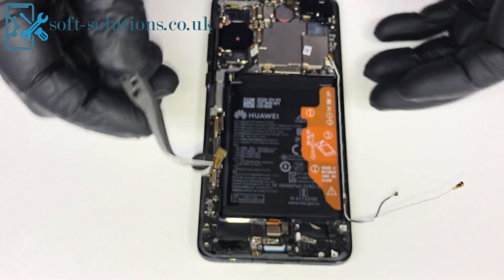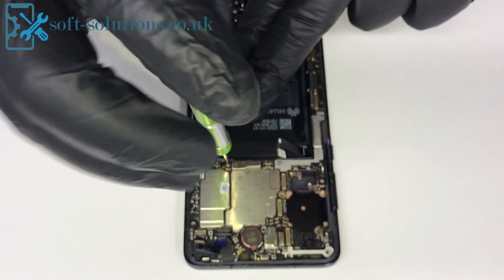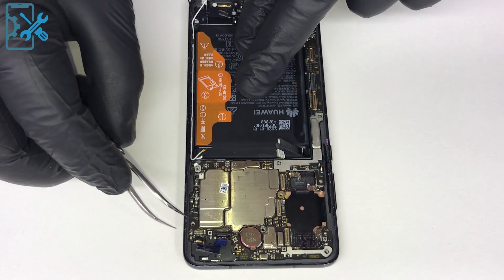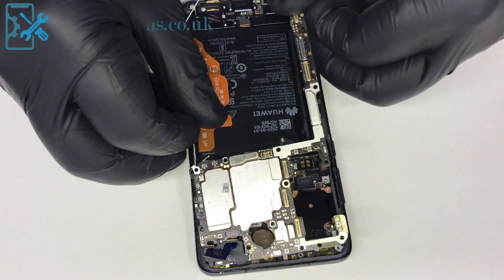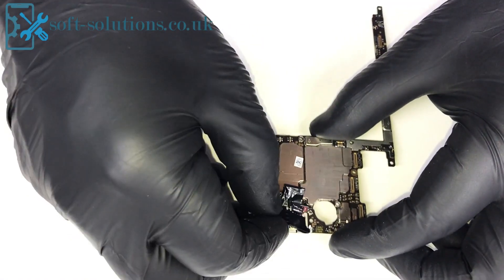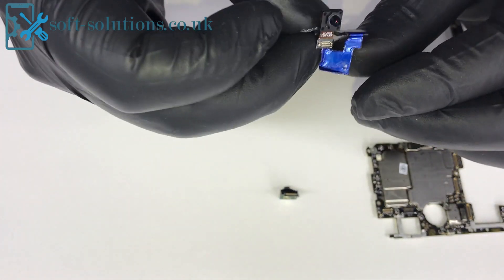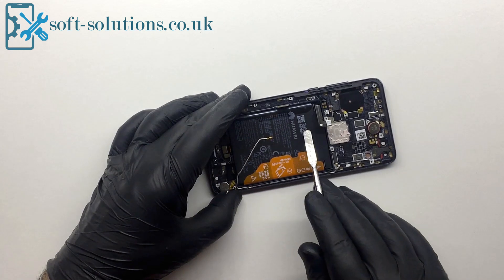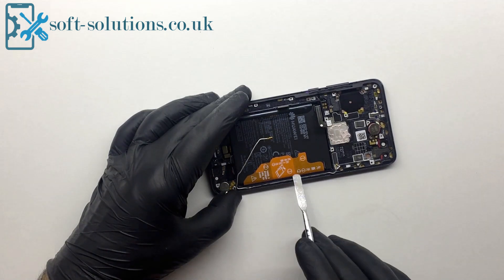Same old style vibrator. Now we'll remove the motherboard — for that we have to remove the screw first, and then gently take the motherboard out. These are the two front cameras. In order to remove the battery, remove strip number one first and then strip number two, and gently pull the battery towards yourself and the battery will be released.